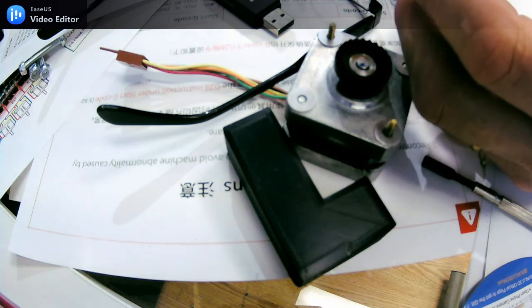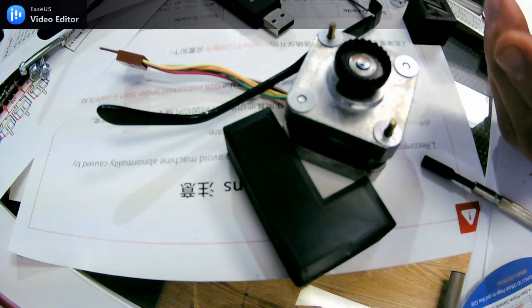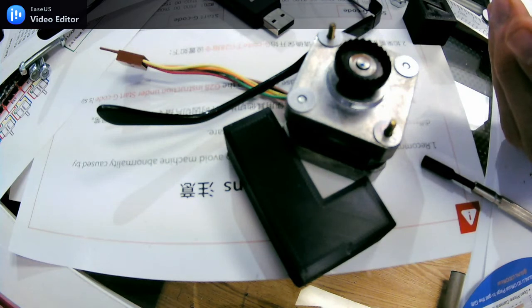While I was looking around, I noticed that in the Windows Device Manager, every time I plugged in the printer, it would flag an error. It looked as though the printer was talking like it was an RS-232 port and not a USB port, and so it needed an RS-232 driver to be able to do that.